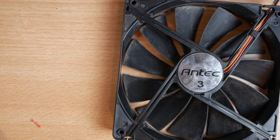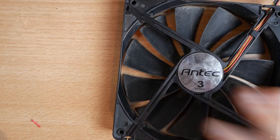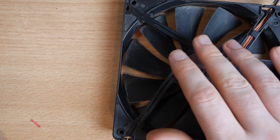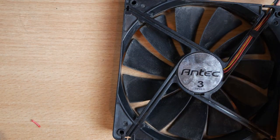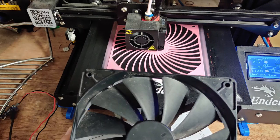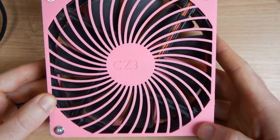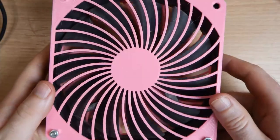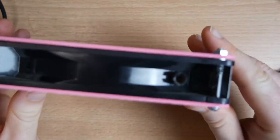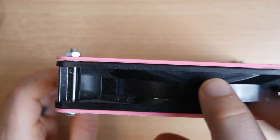My main concern was that the PC fan blades are completely exposed — probably fine for big sausage fingers like mine, but not great for little fingers like my kids'. Since they stole the good fan, I needed to do something. I ended up 3D printing fan grills I found on Thingiverse and they came out pretty good. I only had three screws that fit, but it's enough to hold them in place. The back blades were a little close to the grill when mounted directly, so I used some washers to keep the grill away — that worked out great. Both grills took about three hours each to print.